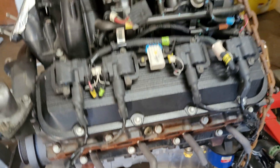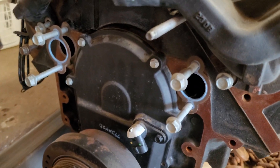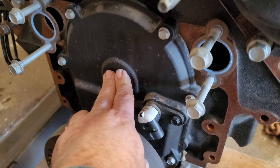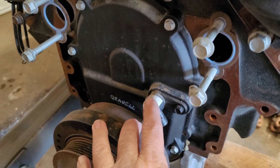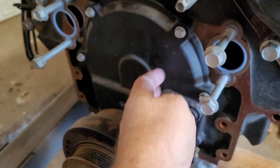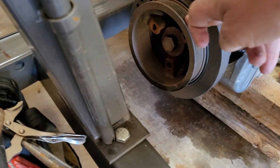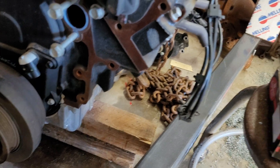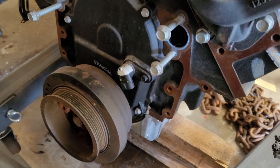The other thing that's different on this versus the '04 is the marine versions have a different timing profile, probably for a little bit of extra horsepower. They have a different cam sprocket and a different crankshaft sprocket. The cam position sensor is different on this '02 and the timing chain cover versus the '04, which I've already pulled off and cleaned up on the other one. I've got to pull the balancer off — this balancer is more of an old-school style with threaded bolts, whereas the other one was more of an LS-style balancer, so it was quite a bit different.